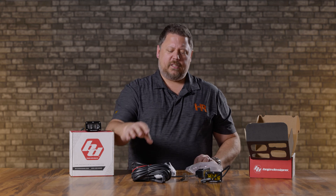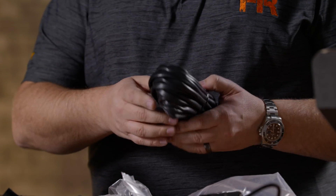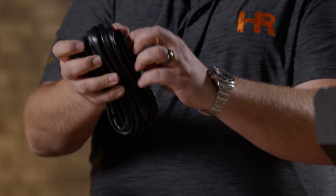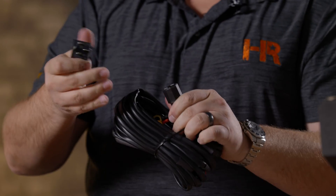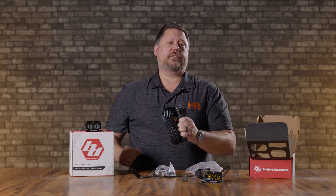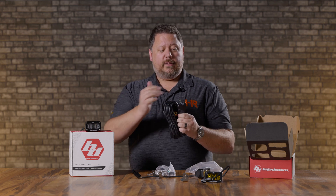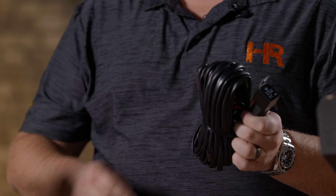The wire harness connects to a large relay harness. It's not as nice as some that are out there, because some of the components are not waterproof. Here is just a basic automotive 12-volt relay without a waterproof connector — normally you'd have a rubber seal and clips that provide positive tension to create a small seal and keep water out. This one doesn't have that, which is a water ingress point that can cause problems down the road.